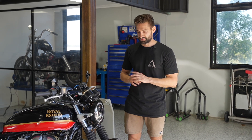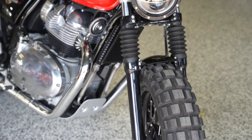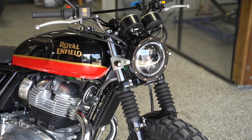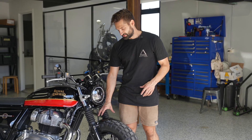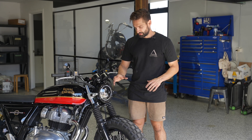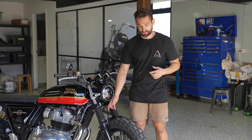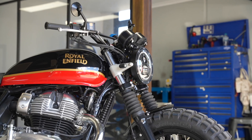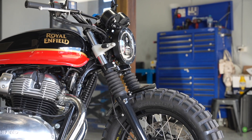The tyres we're running on our new XL rims are a Continental TKC80. With that mod we've had to change a few bits and pieces, especially on the front end. The standard front fender was scrapped and we've rebuilt a custom fender using our rear fender kit — a wider fender we've released just recently. Because we've got a big bold wheel on the front, we've gone with a fat fender that just uses a factory mount. A pretty easy mod if you know what you're doing with a welder and a grinder.